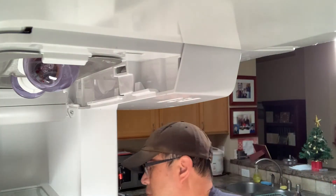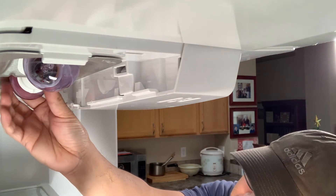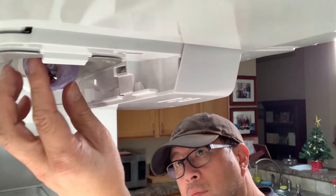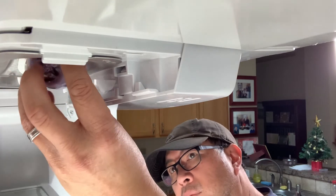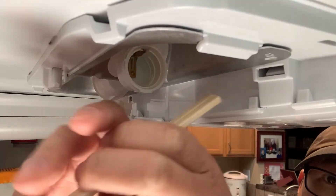The main control board is located inside the housing for the temperature controls. This housing consists of two parts. The first thing I did was try to remove only the front control panel part of it, so I needed to take out the light bulbs first. It's always a good idea to take the bulbs out to avoid breaking them. Here's how I tried to remove the control panel.